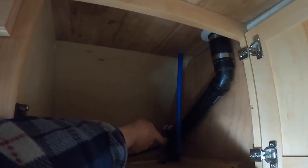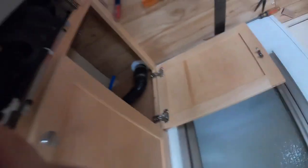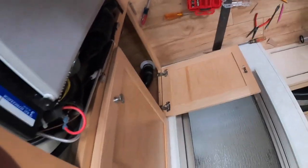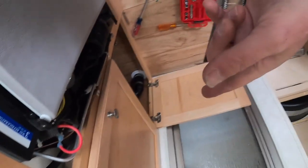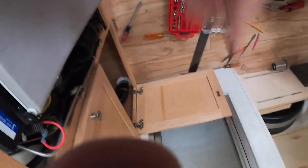Let's go inside and I'll show you inside the trailer. This is where the tank was in this part of the kitchen cabinet, and that's my line coming in. I'm going to tie it right into the blue line right there — the high-pressure line by the sink. So that's it, guys. This video is getting plenty long. I've got one more connection to make and then the lines are connected. I'll have to get the vent line run and the fill line run, and that'll be in the next video. So stay tuned. Thanks for watching video 10. Stay tuned for video 11, where we connect up additional lines to the tank. Take care. Drive safe. Bye-bye.